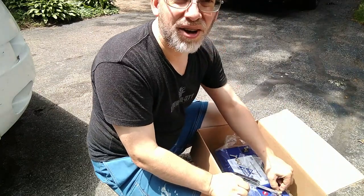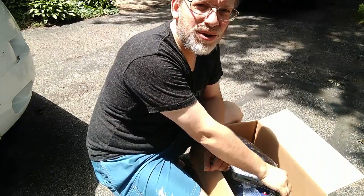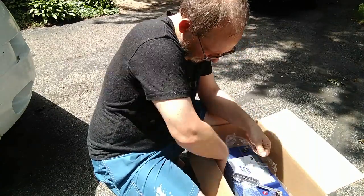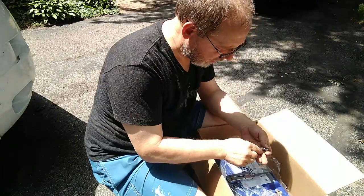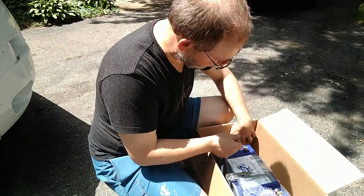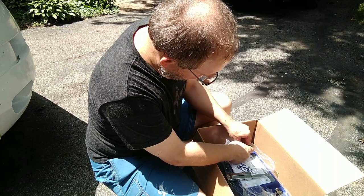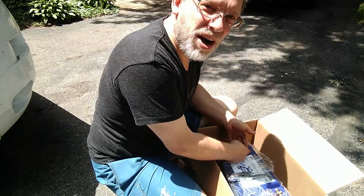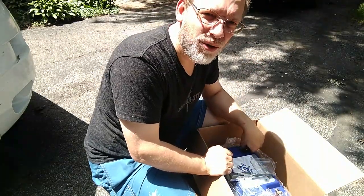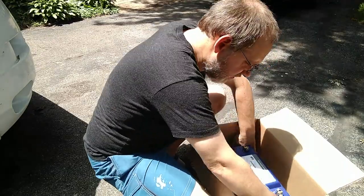Snug up the nut until it's just finger tight. This is now not going to come off the battery, and it's ready and available — you can't lose it during moving the battery around or testing how it's going to fit. Short bolt, washer through the post, from the center towards the outer edge of the battery, washer again, finger tight. You'll need a pair of half-inch wrenches to tighten these really tight so cables can't rotate. I've saved the heat connectors.